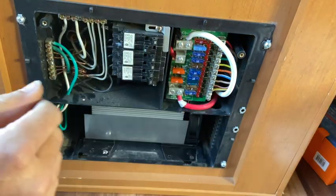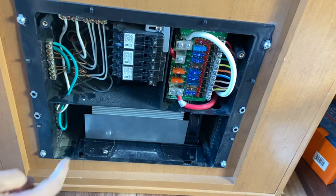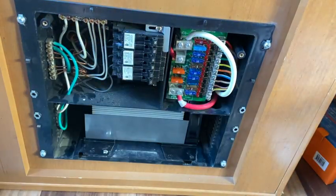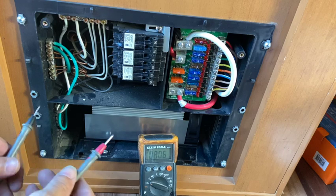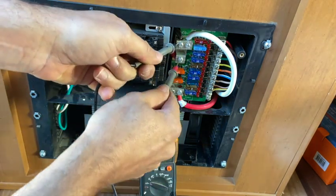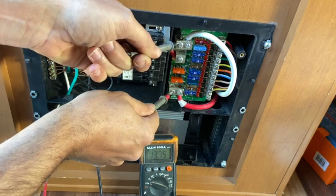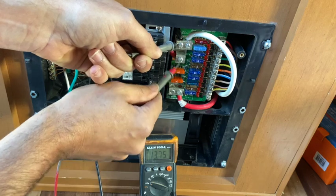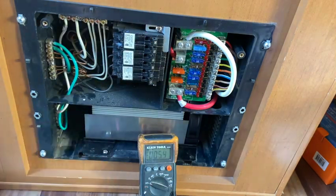I've got the battery connected, the power on, and the breaker on. Now we'll just check and see that we're getting power everywhere as we should be. For DC over here: 13.75V is coming through now. We had 13.4V before, so that's good — it's raised it up for sure. 13.75V, so it's definitely going to a higher charge rate than it was before. Now let's see what we get in the battery compartment.